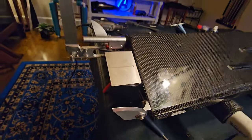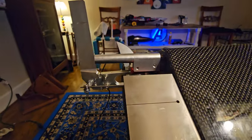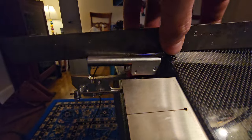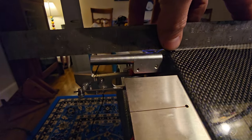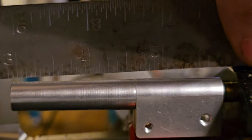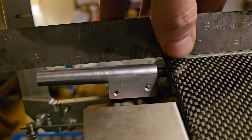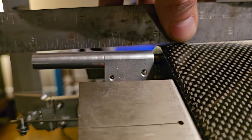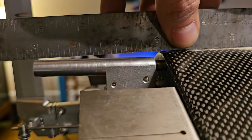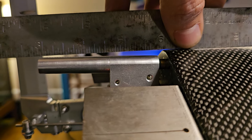What I noticed on my runs and on Ironclad RC's video is that with his Dominator he wore out the bushing shaft and broke his flex shaft. I'm going to try to use a straight edge and show you — look at that degree change from the boat to the rear of the stinger. I measured that and we're right at two and a half millimeters.